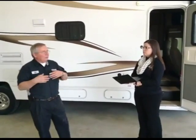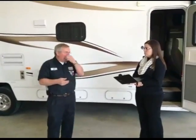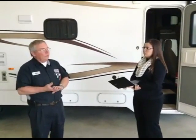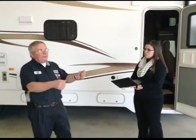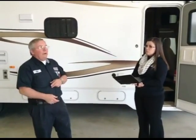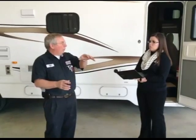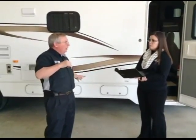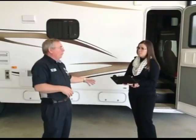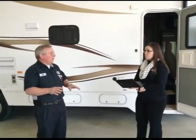And so then it looks like our last question is wondering if their generator is powered by propane, if the same rules apply, which I'm guessing they're referring to the exercising that we were talking about. They want you to exercise it regardless. Yep. Diesel doesn't really go bad when you let it set in the lines like gas does, and propane won't either. A lot of your commercial units will run propane because you can leave it in there for years and not have to worry about it going bad. But as far as exercising the generator, they still want you to exercise it. It's good for the electronics in it to get warmed up.